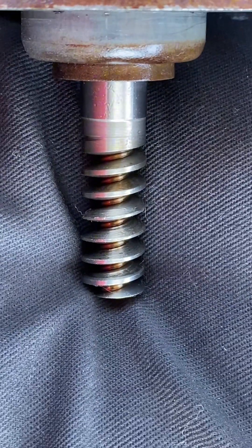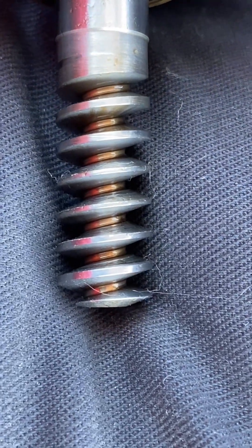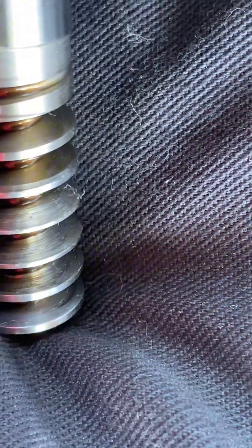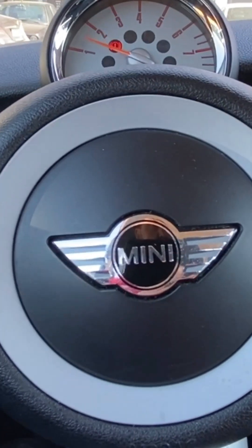The only thing I can't tell you is why it was only cylinder four. There is an issue with the lift part of the Valvetronic on number four, and also an issue with the motor itself. Look at the teeth on the motor that was replaced — the top two and bottom one are quite reasonable, but in between they're starting to thin and blade out like little sharp discs. They're digging into the Valvetronic eccentric shaft teeth, and that digging and polishing is going to stop the thing working properly. That's the main reason why this has failed.